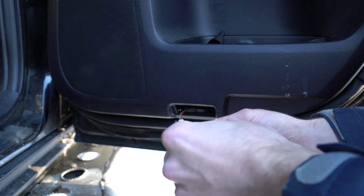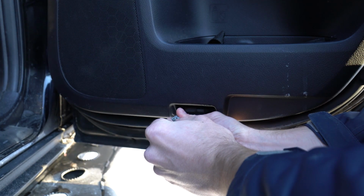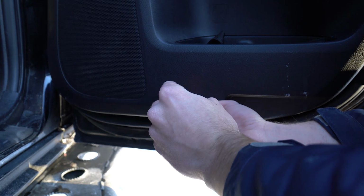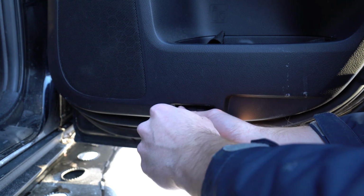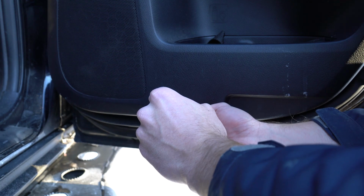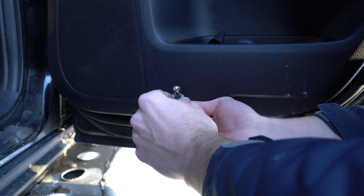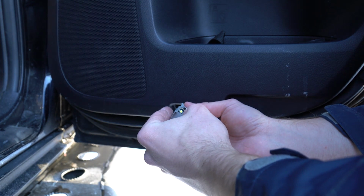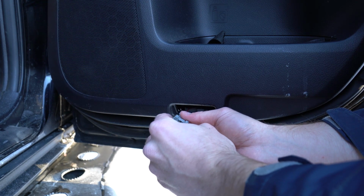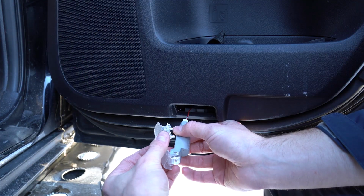One thing I noticed is these aftermarket light bulbs are a little bit thick for that connection point. So you do have to press pretty hard, and I tried my best to hold the light bulb on the outside of the housing when I was pushing it into this socket, but it still seems like you're maybe going to break something. I didn't have any issues, but you're definitely going to press really hard, and the farther you push it in, the more space that light is going to be able to bounce off of the sides of that plastic gray circular cover that goes around the light bulb. So definitely try and push it in as far as you can, because there is an LED at the end of that aftermarket light bulb.